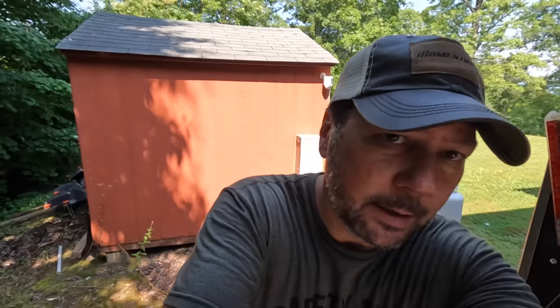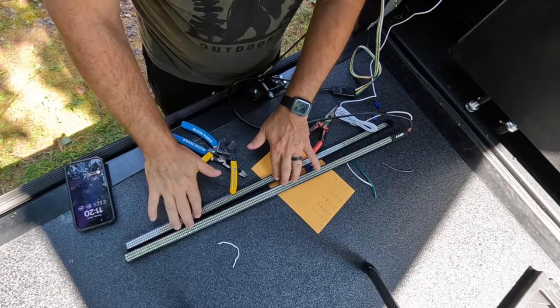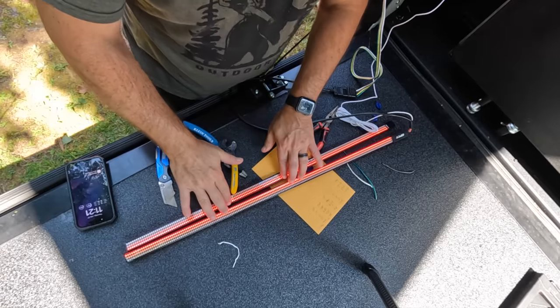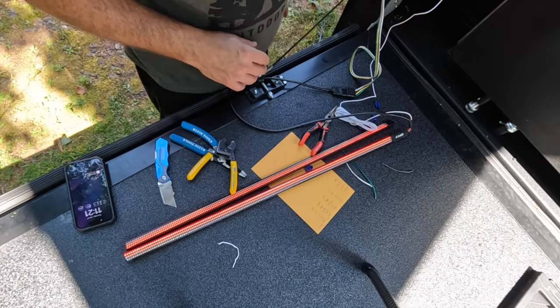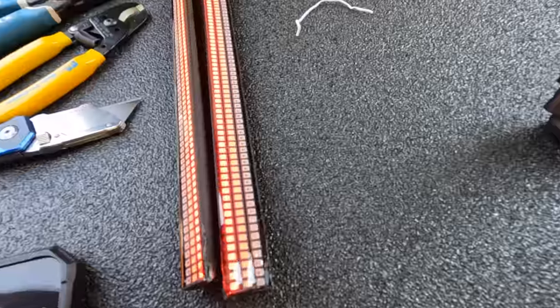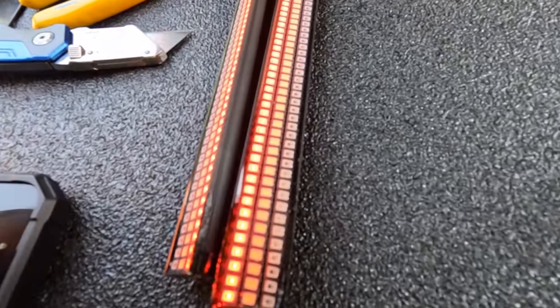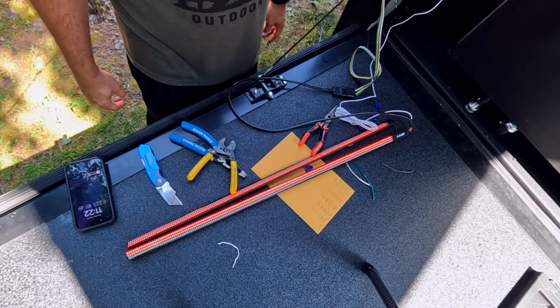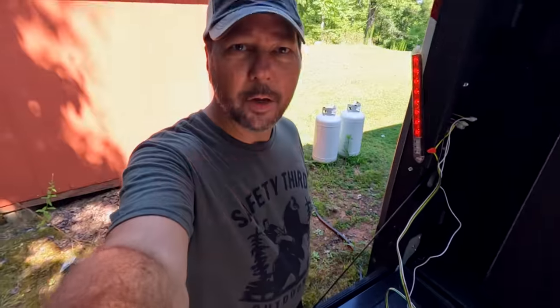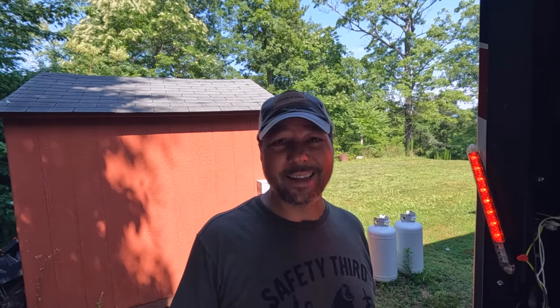Now we shall hook up the truck, turn it on, and try the various modes. I'm going to hook up the truck and take you guys back there to watch it as I turn it on. I hope this works — if it does, I can wire it up and be done today. I love wrapping up projects to completion. Here are the lights all hooked up. First, just running lights — that looks good. Now let's try a left blinker. That's not good. Down here, just the first block is flashing. So I am going to need that part. There's really no sense testing further. The blinker functions don't work and that's their primary function, so I'm going to need that adapter. Now I've got to go search and find it.